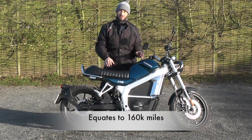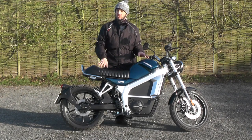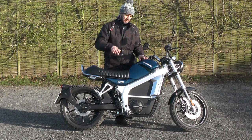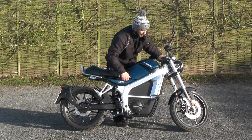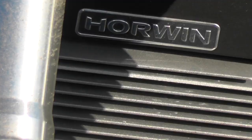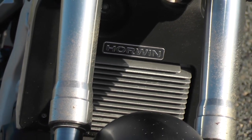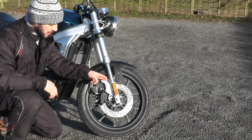Horwin say the battery will last for 2,000 cycles — I'm guessing that's to a certain percentage, factoring in some degradation. The 18650 cells are the same as in the original Tesla Model S, so they've stood the test of time and are very reliable. The motor is oil-cooled, so no overheating there. Just down the front you have cooling fins for the battery, which is air-cooled — air rushing over the front takes away any excess heat.